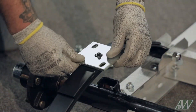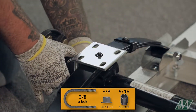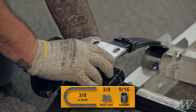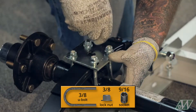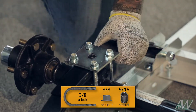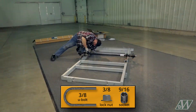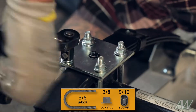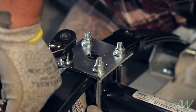Line up the leaf spring mount plate with the oval holes running in the same direction as the leaf spring. Put the first U-bolt around the axle and hand tighten with the locking nuts. Do the same with the second U-bolt. It is critical that you align the hole on the axle to the nib on the leaf spring while securing all U-bolts with a 9/16 socket. Do the same installation on both sides.